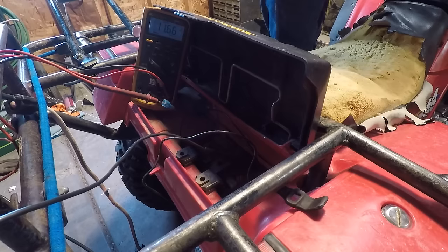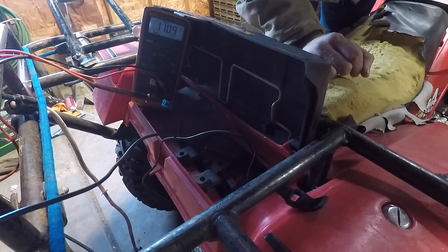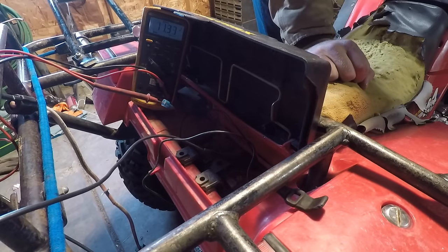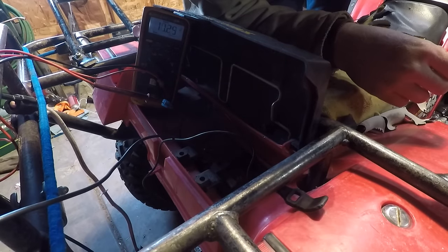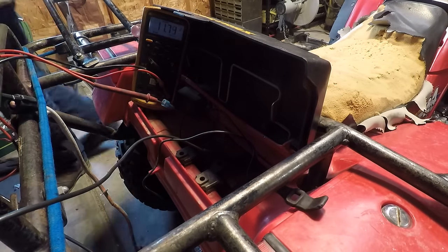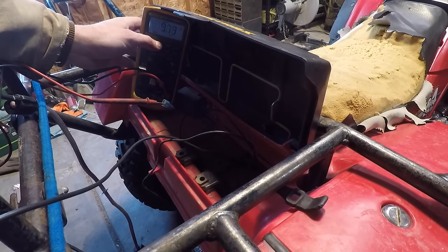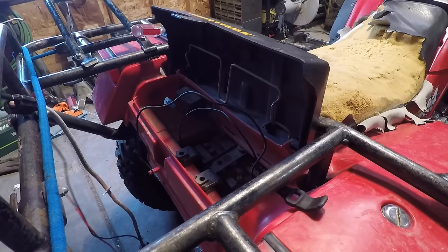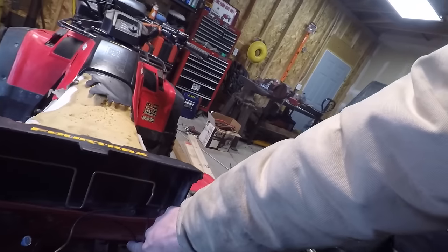Is it even trying? Well, we're losing — how low are we dropping? I don't trust that. Here's our problem: I didn't have a real great connection with my ground lead, and because of that, with the meter set to record, when I bumped that meter lead it broke the connection just enough that the voltage dropped. The meter recorded the lowest voltage, which was caused by me bumping the lead and not necessarily by this thing failing to start.